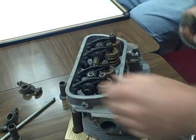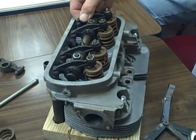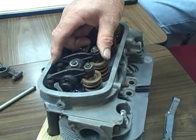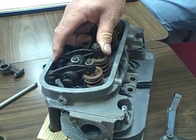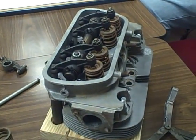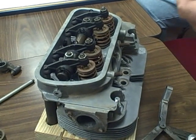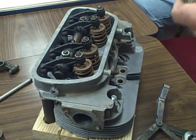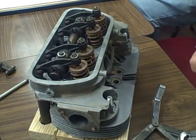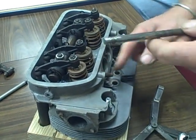If your rocker arm is loose on the shaft — on your adjustment — it beats the end of the valve off and it's not allowing it to fully open. When the push rod comes up and rocks the rocker down, if you've got too much of a gap, that's not allowing your intake or exhaust to open all the way. You will not get the gas and air mixture on the intake that you need to run. And if it's too tight on the exhaust, it will build up the heat on the cylinder and burn your valve.